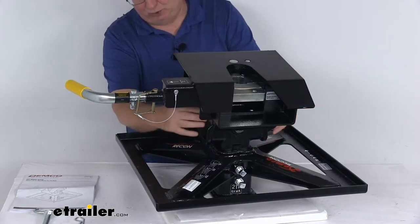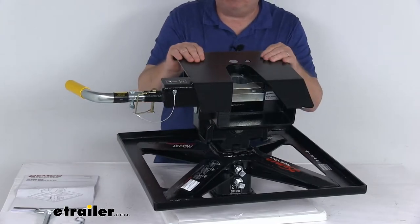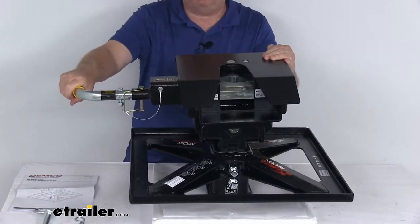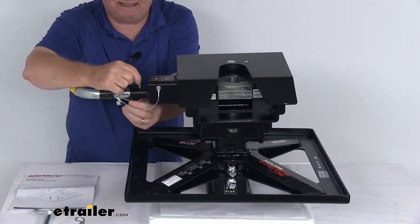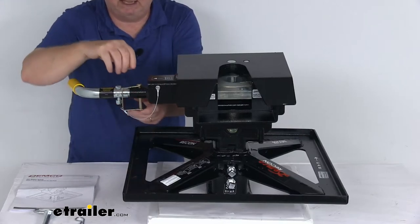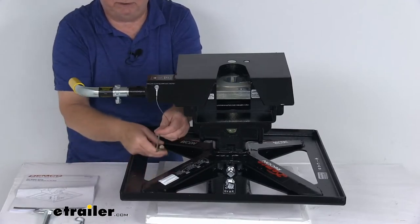In the bottom of the yoke where the hitch head sits, there are cushioning polyurethane dampeners that help reduce noise and absorb road shock. The handle is a nice spring-loaded handle with a comfort grip that allows for simple coupling. It has a tethered safety pin that lets you secure the handle in the open or closed position — just lock it in, and to open it just remove it. Since it's tethered, it stays in place so you don't lose it.